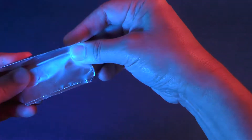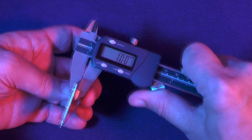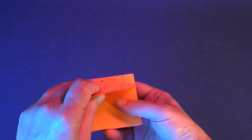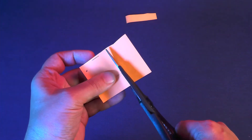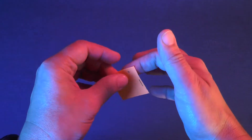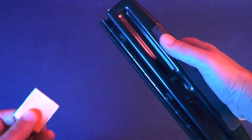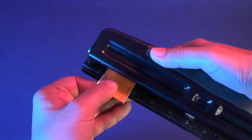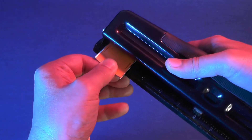Roll your caliper very tight as you are doing the measurement, because the aluminum foil will be squeezed by the screws when it is in its final place. Now you cut your template to size and stick it to your aluminum foil origami. With large scissors, trim your aluminum foil spacer to the size of the template. Now borrow a paper hole puncher from the office, push your aluminum spacer inside of the paper hole puncher, and then pull it out a little bit. If you do it like this, you should get holes in the perfect location.